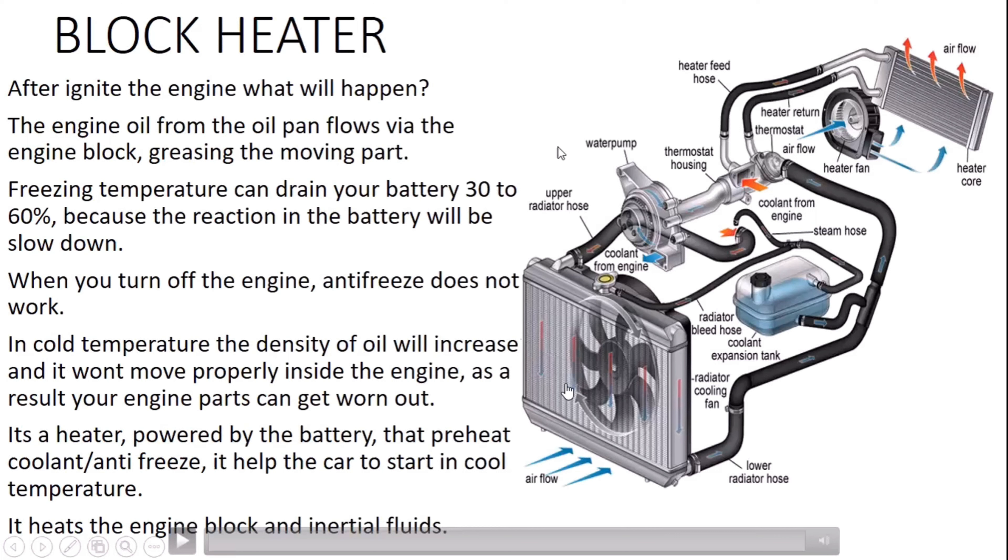When the water temperature reaches, for example, 100 degrees, the blower fan inside the cabin will actuate. When hot water goes to the heater core through the pipes, the fins of the heater core become heated — because hot water at around 100 degrees, which is the boiling point, is flowing through. The blower fan, located behind the heater core, takes air from the cabin and passes it through the heater core.